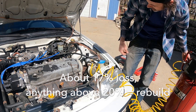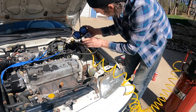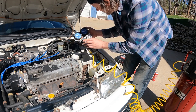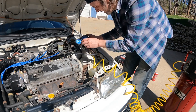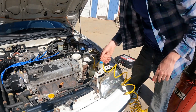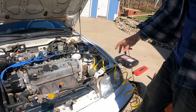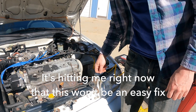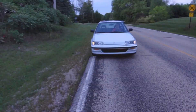I'm not sure what that equates to exactly, but if I turn the supply up to 100, the cylinder reads right at about 80 percent, which is right at the limit where you need to start looking at things. The air does seem to be bypassing through the rings, not through the intake valves or the exhaust valves.